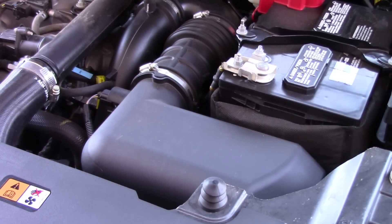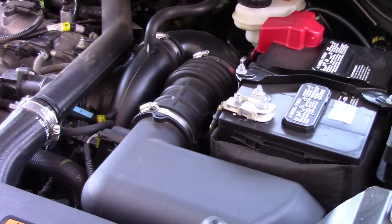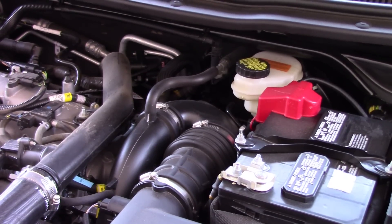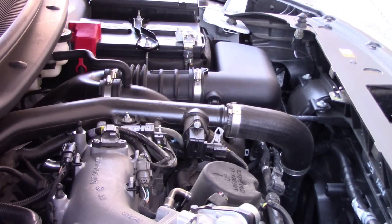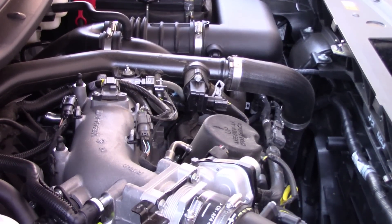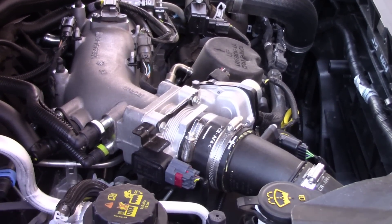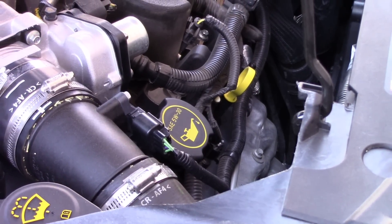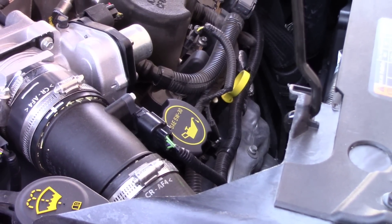Following the airflow here is a little bit tricky as there's a lot of plumbing both seen and unseen. From the air filter box up front, the stream is split in two, each turbocharger getting its own intake tube down below. From there, the boost pressure heads to an air-to-air intercooler up front and then back up top where it flows into a single-throat throttle body and into an aluminum intake manifold.